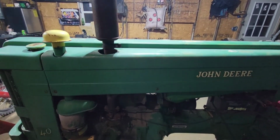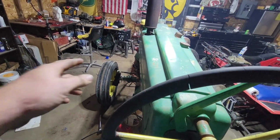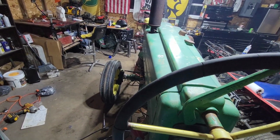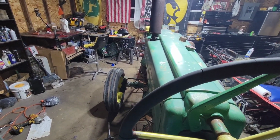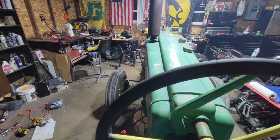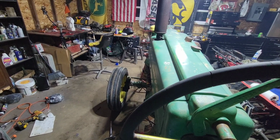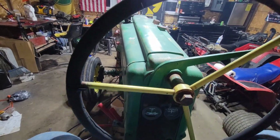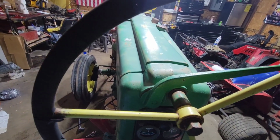Till next time. So I actually decided not to end the video there. Did go through that oiled air cleaner. She was plumb full. I'm not sure what all was in there, but it was definitely some oil that tried to coagulate with some water and leave a whole bunch of sludgy looking junk at the bottom. So I'm pretty happy that I left that off, because man, that could have just ruined the whole car, but it's got done cleaning. I did a little bit of tunage. We're not quite right where I wanted to be yet, but she ought to pop off.